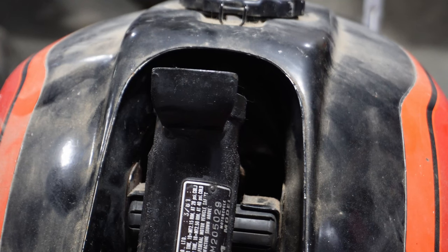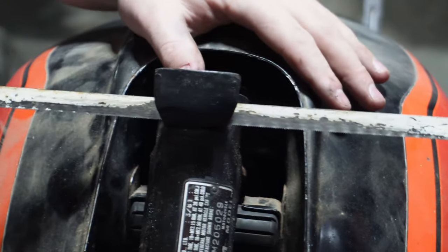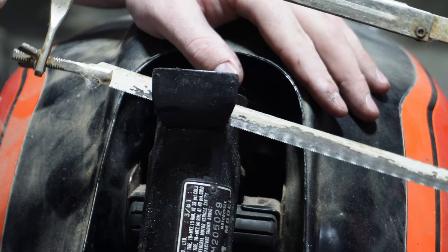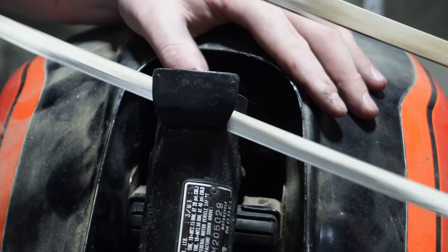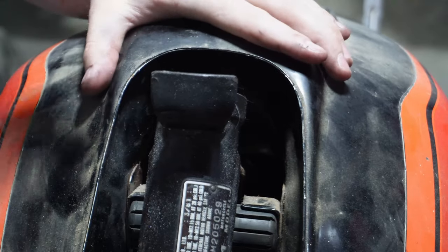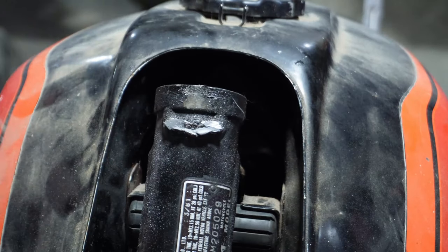You're probably going to find this a little funny — I can't find any cutoff wheels, but what I did find is a hacksaw. I've just been slowly cutting away at it. Thankfully it has a decent blade in it. Oddly enough, I actually feel more secure doing it with a hacksaw than a cutoff wheel, because those cutoff wheels take off a lot of material real quick and I don't want to clip the tube. This is just a nice easy way to take it off. Just give it a little tap — and there we go. No more steering stop.